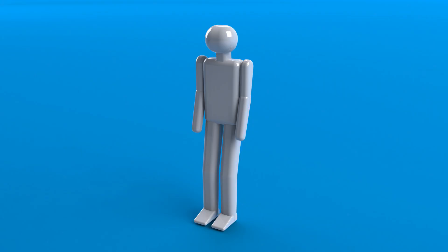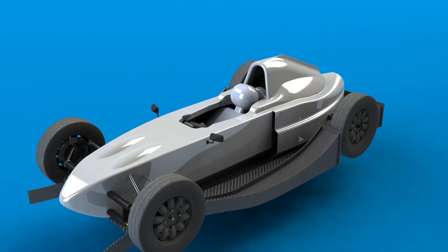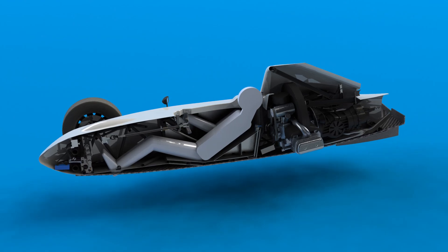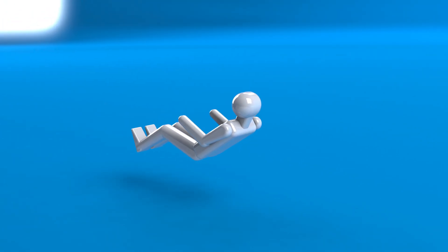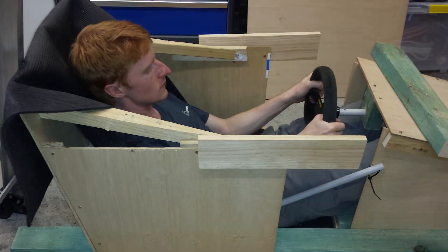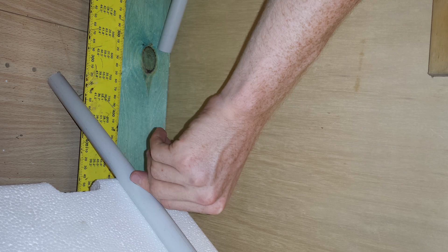In order to make sure I fit in my car, I got a tape measure and measured up all my limbs to create a simple dummy in Solidworks. I did most of the design making sure that this dummy would fit, but ultimately it's important to double check things in reality. You might technically fit but be so uncomfortable that the car is close to undriveable. For this reason we built an ergonomics jig just out of wood, with the same dimensions as the chassis and driver controls mounted in the same location. I found I had to extend the car's legroom by about a hundred millimetres, but apart from that it fit really nicely.